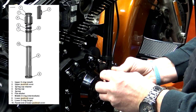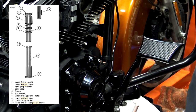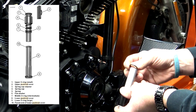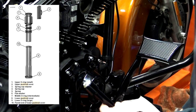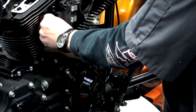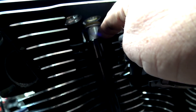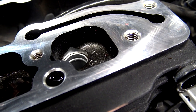Grab your bottom push rod tube, put your O-ring on there, and put it back down. Grab the inner, put the cap on, slide the cap to the top, put the spring on, put a flat washer on, and put your O-ring on. Then pick up your bottom push rod tube, slide this together, and get your top O-ring that goes into your head — put it on here. Take this and put it into your intake side, sticking the bottom of the push rod into the top of your lifter cap. Once it's set in the bottom, pull your inner tube up and you can see that O-ring seating up in there — those are the ones we pried out earlier.